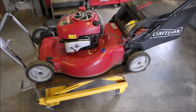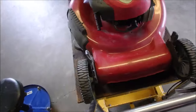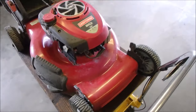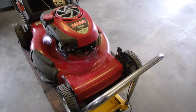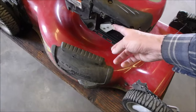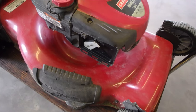When he dropped it off we pulled on it a couple of times and it wouldn't start. It has the automatic choke, which means there's no primer button right here. I got it running with a little shot of petroleum products into the carburetor. It fired up and I could keep it running like a choke if I put my finger in here — but pull my finger away and it would quit.